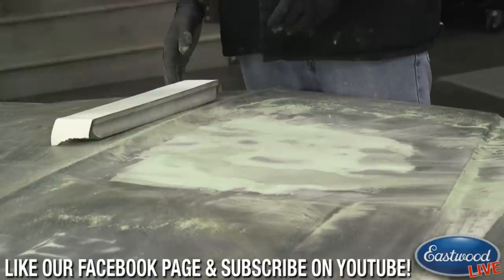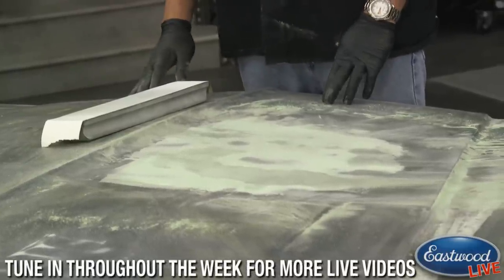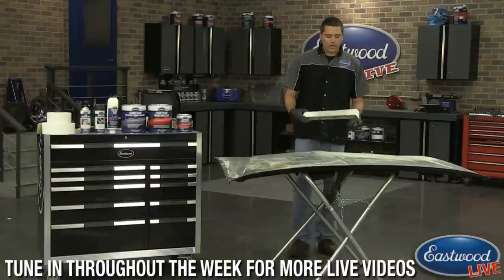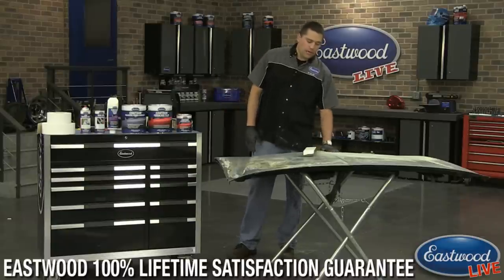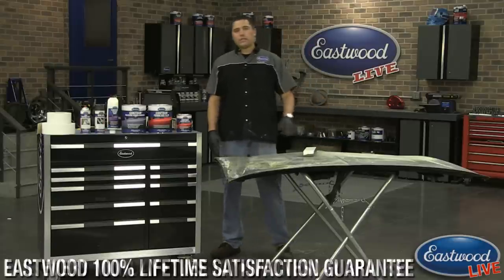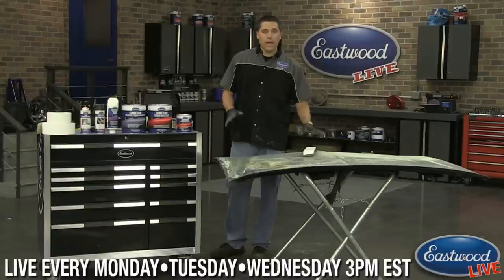So if you put it on, you take it off, and you took too much off, no big deal. There's some more body filler in the can. Mix it up, put it on, and keep working it. You'll get it. It's really not bad. It just takes a little bit of practice. So with that tip, being able to run your hand flat on the surface is a huge deal to be able to feel where your highs and your lows are. But say that's completely taken down to 80 grit, it's feathered, the edge is really nice, I'm happy with it.